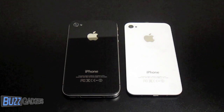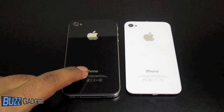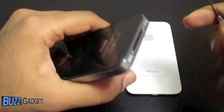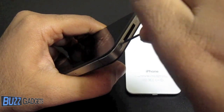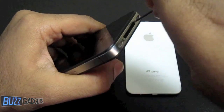Alright, so here we are with the installation. First thing we're going to need is the iPhone, the new replacement glass, and a 00 type screwdriver. Now we're going to go ahead and go to the bottom of the device and remove the two screws surrounding the 30 pin dock connector near the speaker and the microphone of the iPhone 4.